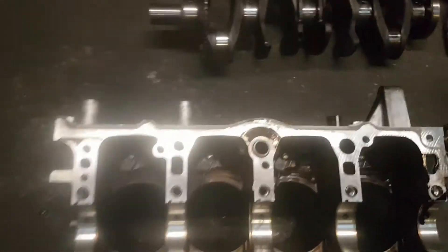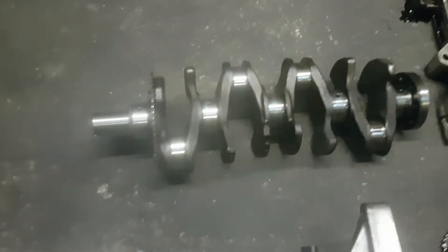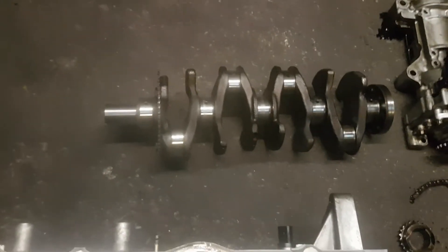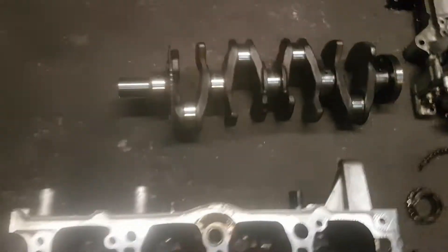The engine needs to be stripped, and in this case there is damage to this crankshaft. There is scoring on the main journals - which is hard to see because of the light - and scoring on the big end journals. So that crankshaft will need to be sent to the engineering shop, where it will be checked for balance and trueness and surface ground, with bearings to suit.